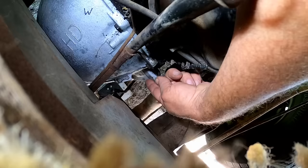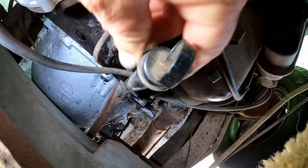The bracket comes off the dipstick tube right there. The bolt goes through it and holds the dipstick firmly. Hopefully we'll be putting some fluid in this after a while, so it's probably a little empty right now. And the two bottom bolts down there are tight as well. So all six transmission bolts are nice and tight. And the torque converter is still free and spins. We'll have to put the torque converter bolts in.